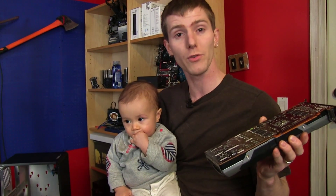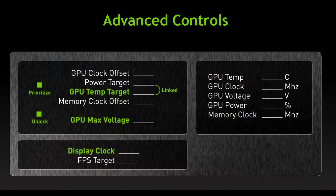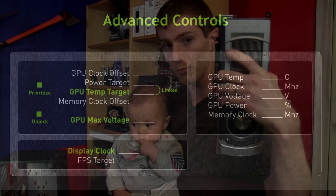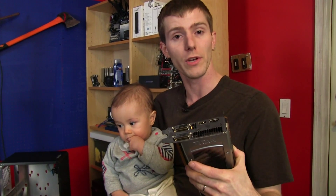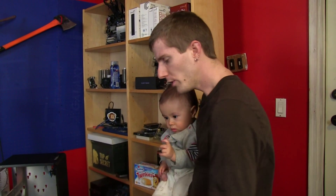What that means is you can say: 'I'm comfortable with 90 degrees. I'm going to set a target temperature of 90 degrees.' Unlike a power-based target, it's not approximate anymore. The fan will ramp up as soon as it hits that 90-degree target — or 80 degrees, which is what it ships at, or even 70 degrees. This allows the card to dynamically adjust clock speed and voltage to make sure it runs at that temperature. What's the application of this? Well, you could do a couple of things.